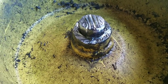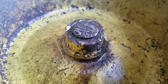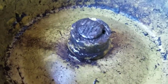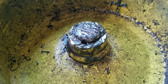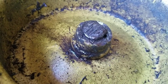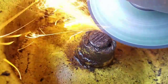I banged it back down again, maybe two millimeters — it's at the very end now. I'm going to liquid wrench it again and try to bang it back out. Using the chisel, I've gotten it up to that point again, but it just won't go anymore. At this point I've damaged the transaxle already. If I was ever going to use this transaxle again, I'd have to weld the wheel on. But I don't think I'd have any trouble, because you can't even get the wheel off — if you put a wheel on here, I'm sure it'll hold. Of course, I've now mushroomed it again.